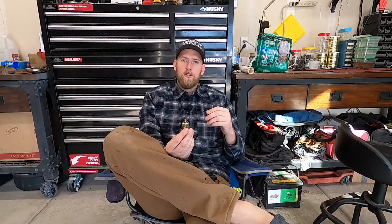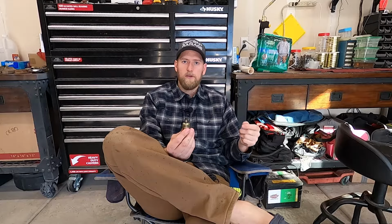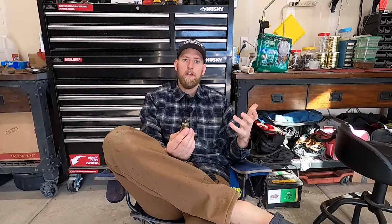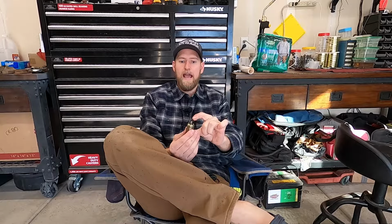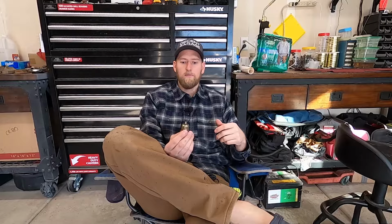The issue is that when you start messing with your fuel supply and your fuel load on your pump, playing with the fuel screw, governor spring, timing advance, fuel pin, all of the above, it starts to increase the load. When the plunger is then activated, little chunks of this rubber tip start to get broken off and go into your pump and into your delivery valves, which can cause issues. And the main issue that it causes is your truck won't shut off. So if you've had an issue where your truck won't shut off, this is probably the culprit.